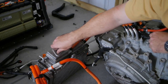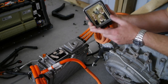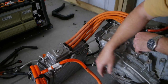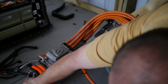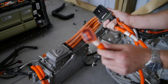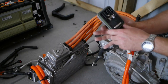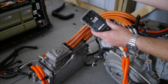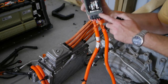The inverter has a similar connection, as well as the charger. For the inverter, you're running three connections instead of going to a blade style terminal. They actually crimp on these ends, and the crimped end is what makes the contact directly. This is the charger connection — this goes off to the Lear charger. It's actually a Lear wiring harness. One side goes to the charger and one side goes to the actual pack. Inside of here it's actually fused with two 30-amp fuses built in.